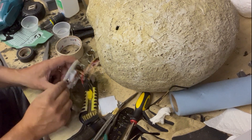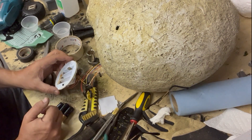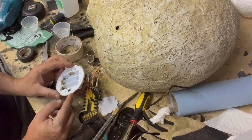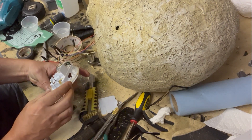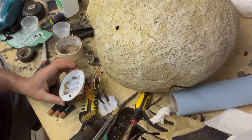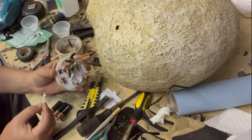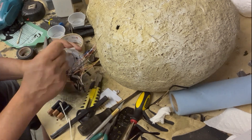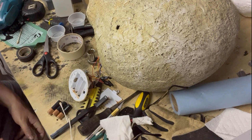So we've rewired everything and did a wire brush on the terminals — still not working. Now I'm going to do a deep cleaning with some white vinegar and rubbing alcohol and see if we can get this going. There's a lot of corrosion on the wire connections too, so we'll try to get that off as well. Okay, here we go — we're going to clean that off with some rubbing alcohol. I'm going to let that dry and then test it. Okay, putting the batteries in to see if it works.